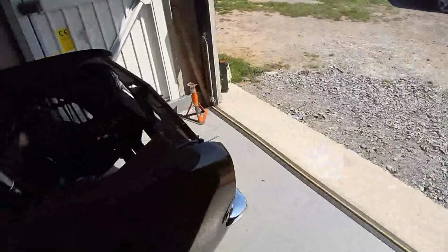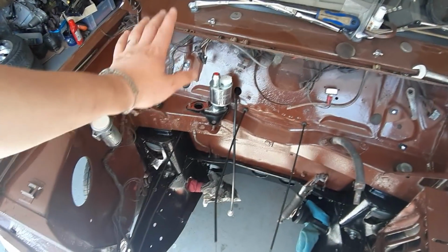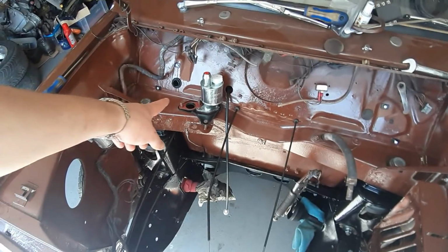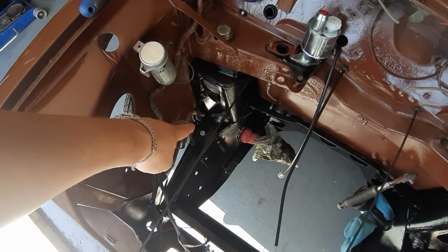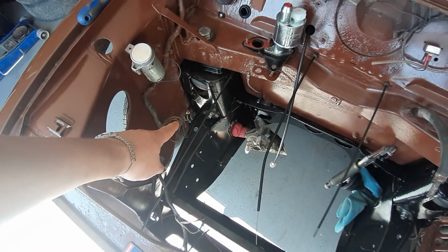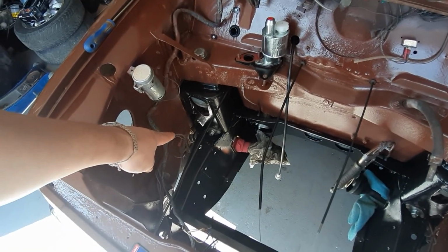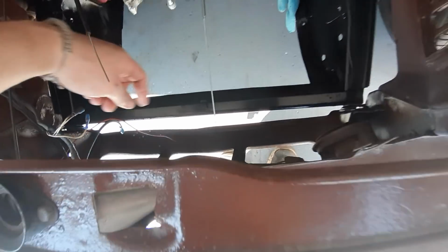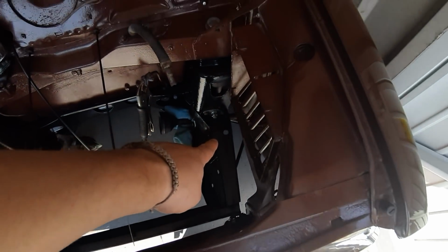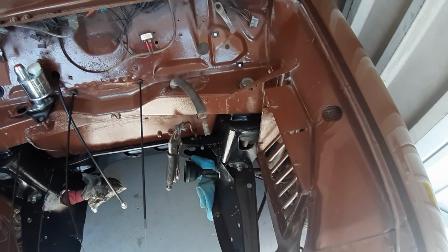Wheels are going to come. Yeah, I've got to put the brake and the clutch master cylinder back in. I've got to plumb the brakes in down to this hole. You can see it just there. And then that goes a flexi hose from there to the hub or to the caliper. The brake pipe then goes down here across the front where I've put this nice little handy bracket or clip. Goes round and then to that little hole there, again down to the caliper.